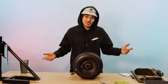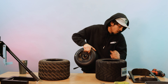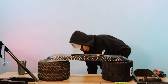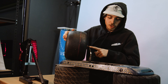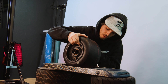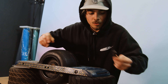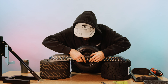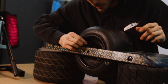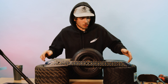Now you've got your tire on. What I like to do is find a couple objects to support your OneWheel. Take your board, lay it up here, and take this tire — make sure your cord is on the side without the cord, because you've got one side with your battery and one side with your motor cable. Just take it, slip it down in — she's mounted. Then get these axle clamps out of the way, put them back on, clip those back in, and put those miniature long screws back in. Don't lose them. Once you get those attached, go ahead and flip over your OneWheel.